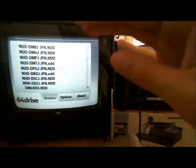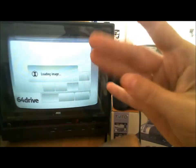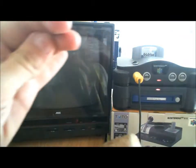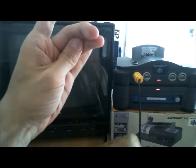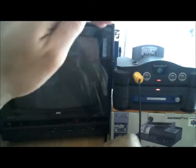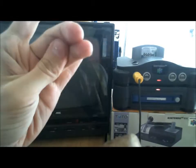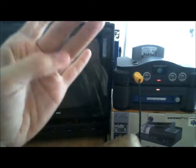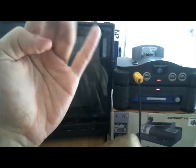It should take roughly two minutes to copy a whole disk. Normally you wouldn't write a whole disk — normally what you would do is you would just give it instructions on blocks of data and where you would put them. That's why it's incredibly important that when you go ahead and dump one of these things, you keep that error log that it generates. Unrecovered read errors aren't just weird errors — they are sections that haven't been written to since the last disk format. If you have those, you don't need to write the whole disk at one time. You can just write back the actual information that you used.